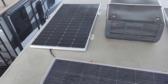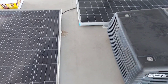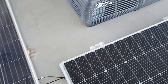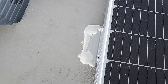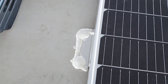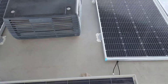We got the solar panels installed and it came out better than I thought, with minimal wires exposed. I was able to zip-tie these to the edge of the original panel. I did it in series — positive, negative, positive, negative — and that worked out good. I had to buy a couple of 10-foot Renogy RV MC4 connector extension cords. I pre-drilled all the holes, moved the panel off, cleaned it with water, put a bead of self-leveling sealant around each hole and between the holes, then after sliding it down I put more on top.